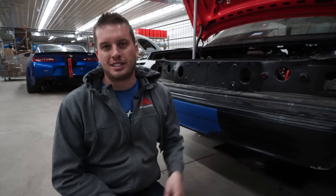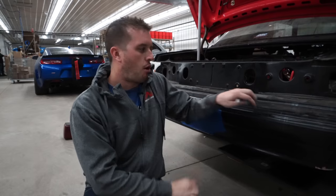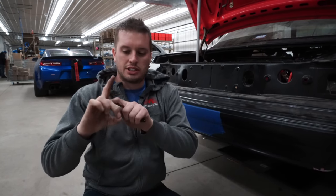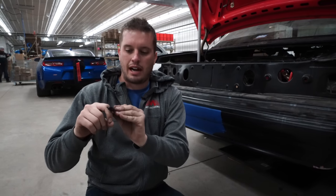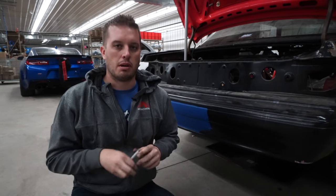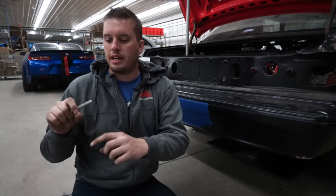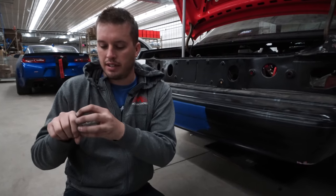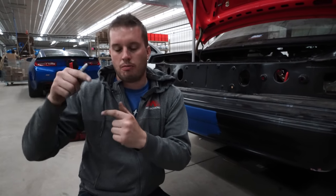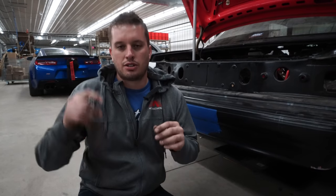All our lifts are tied up today so I'm doing this on the ground like most of you guys are doing. The bumper's back on, so now what we're going to do is trace around the bar — we have our main bar with an inch and three quarter tube coming off it. Our goal is to get as close to a perfect trace around that tube as possible. You want to get as close to that diameter as possible because we're going to use that to locate the center hole we're drilling in a minute. Try to get a top, bottom, and two sides — everything as far as success stems off of this part.